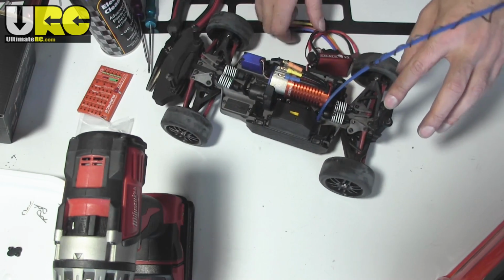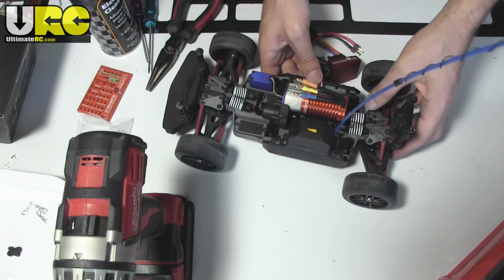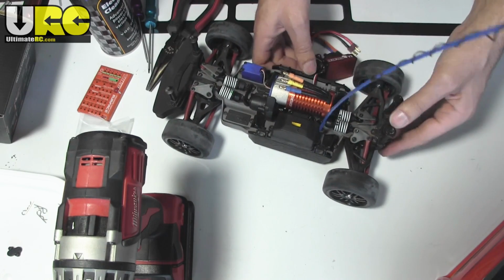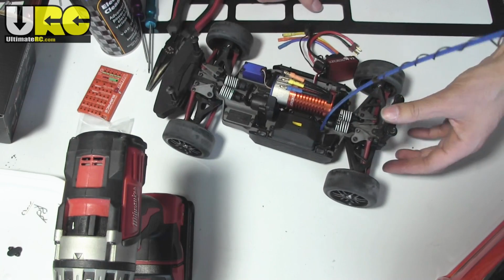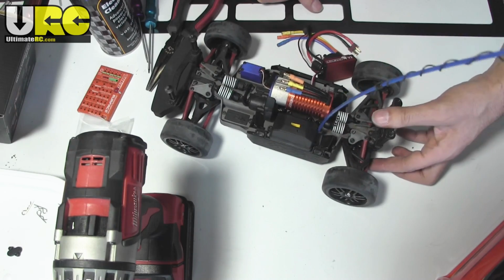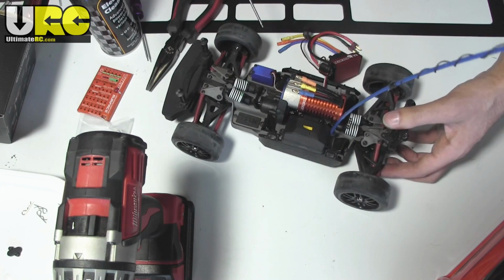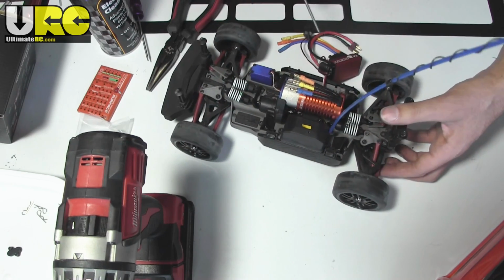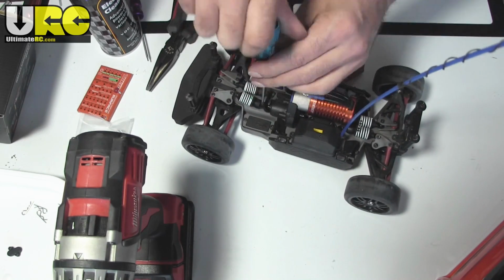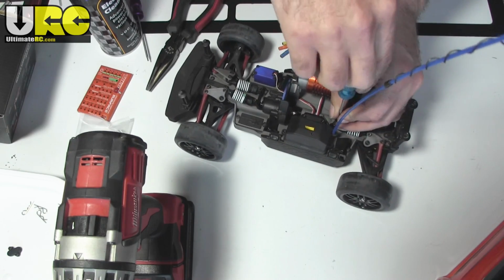Ugh, that's ridiculous. I've taken these shocks apart and put them back together so many times now, going with progressively thicker and thicker oil. I'm now up to 2,000 weight diff oil there, and it's still thinner than I would want it to be. But I'm just tired of taking these apart and redoing them, because you really need to fill these up very carefully since they're on their sides. Any air bubbles will affect the darn thing very easily and quickly.